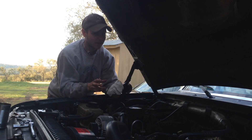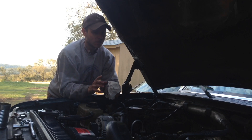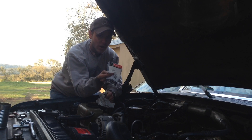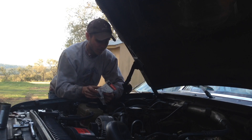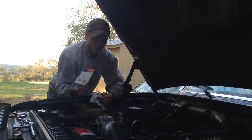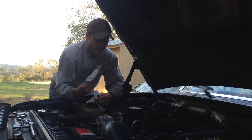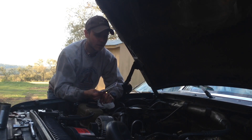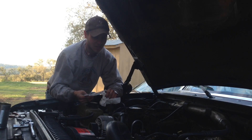The glow plugs I put in actually came in little white boxes — that's a big no-no. The only glow plugs you should ever put in your 7.3 engine look just like this. These are Ford Motorcraft brand, they are ZD11 glow plugs, and they say Beru Germany on the side. These are the OEM manufactured glow plugs and pretty much the only ones you should put in. The old ones I had actually burned out in about two months. I thought I had bought Motorcraft but I didn't.